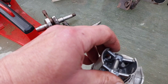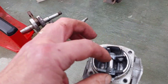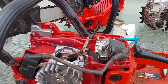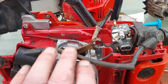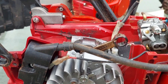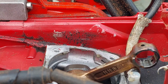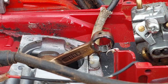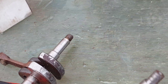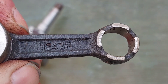I'm going to make the piston work. If it's in there, with room to open up, with lots of air through, it will work really well. But there's a problem. This particular chainsaw is a 62cc Titan Tech, and you can tell by the number on that conrod there — the number says 58. So 58cc and 62cc share the same conrods. But if you go to the other conrods, as far as I know, these are 52cc — so if you use 52cc, it's got 43mm on the conrod.